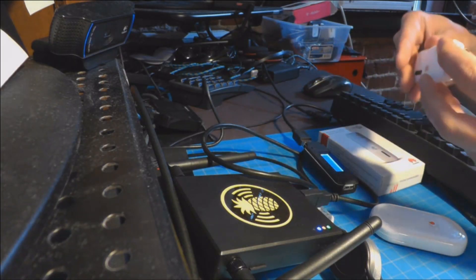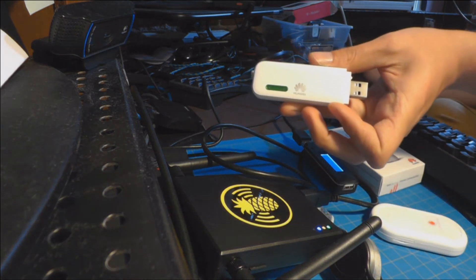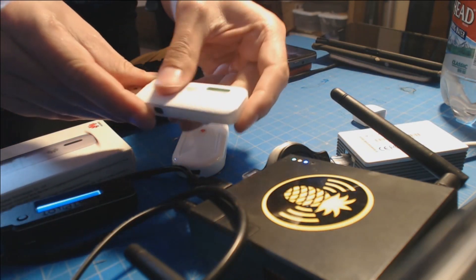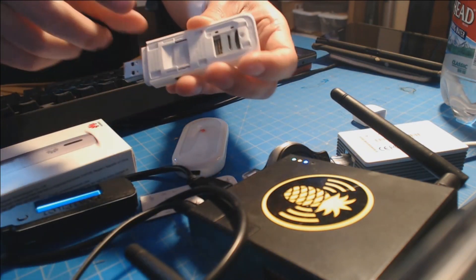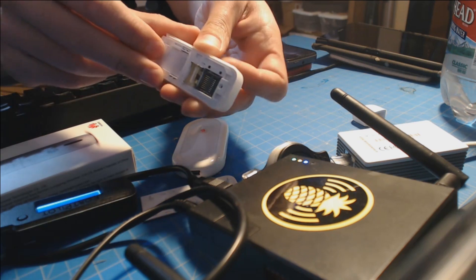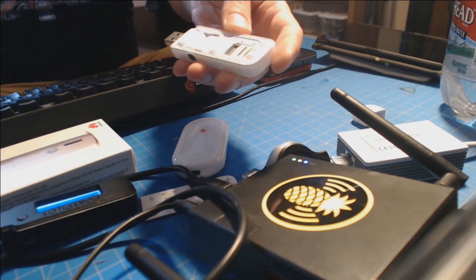We're going to go ahead and do that right now with a CDC Ether-based managed USB modem. I like the form factor on this one a lot more. This is a Huawei E355. The top pops out, and you can see there's a place for your SIM card, as well as a little door mechanism for a micro SD card — because in addition to showing up as a CDC Ether device, if you have a card in there, you can actually use this as mass storage. You can't go wrong with that. It's a very simple device to get set up.